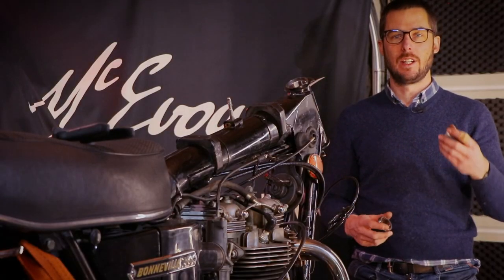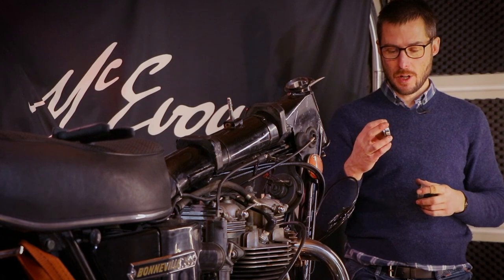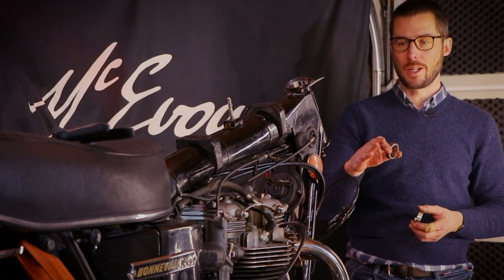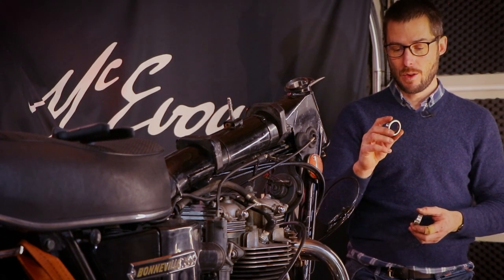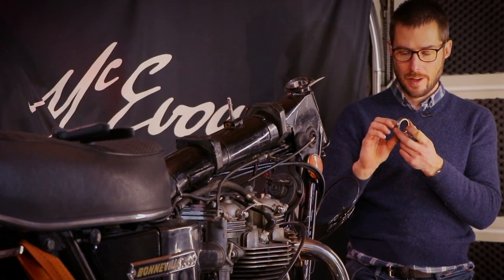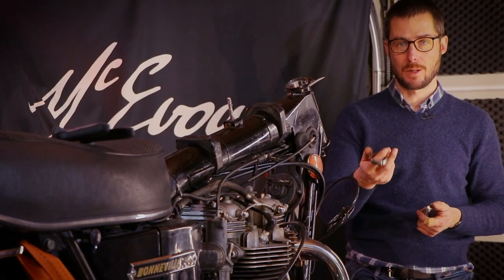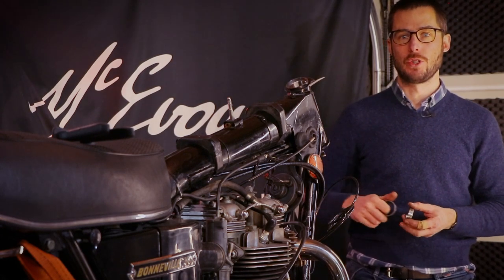There you go. So, funny thing is, the top bearing race is the original Timken made in England fitment, whereas the bottom one is made in Italy for some reason. So definitely this indicates that the bottom bearing at least has been replaced at some point in the bike's life. It only has 4,000 something miles on the clock, and given the wear that this has, I strongly doubt that the mileage is original. Putting on top the fact that this bearing has been already changed, so it's probably been around the clock once, if not twice. So there you have it. That's buying classics. From the outside, it looked beautiful. Didn't have a whole stack of invoices, but in reality, things are slightly different.